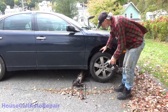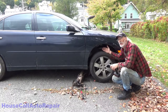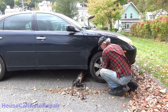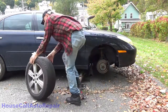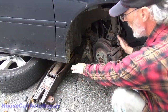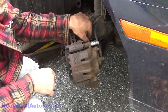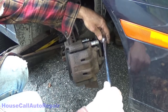As you can see we've got the vehicle jacked up and we've got a jack stand underneath it. We're only going to be doing this one side at the moment because it's getting extremely windy and it's supposed to have some downpours within the next hour or two, so we're going to see how much we can get done quickly today. We've turned the wheel out because this is the only side we're working on. We've already grabbed the sockets — 17mm on the caliper bracket, 14mm on the caliper itself — and I'm going to go ahead and get these cracked loose.